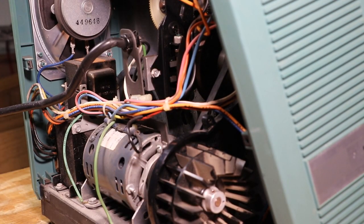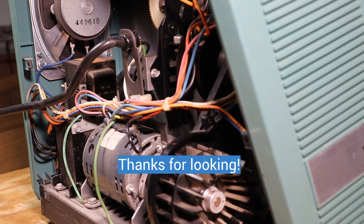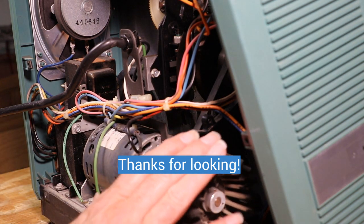That's pretty much it. Putting it back together is just putting these covers back on — exactly the reverse of what I showed you for taking it apart. That's how you put a belt on a Bell and Howell 1500 series projector. It would actually work on a 500, a 2500, and the 100 series — a lot of these machines, this part is identical.